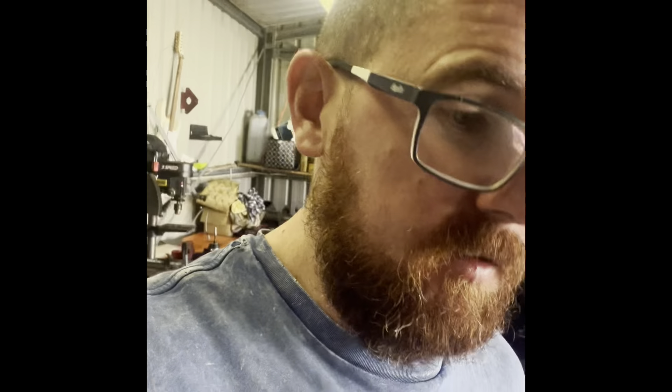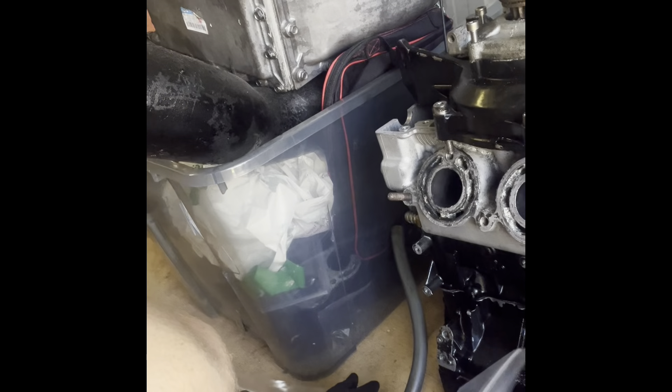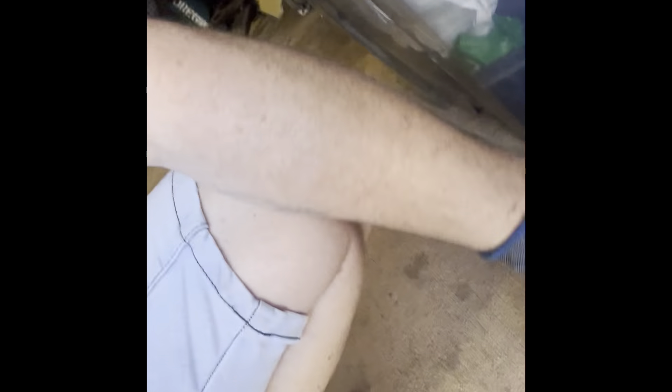The story is I swapped for a Kawasaki 250X. The other thing was in the way, so I wanted something a bit smaller to have a look at. I pulled the engine apart and found some quite bad damage — basically that piston let go, as you can see in the bottom of the sump there. Piston exploded, major damage to the engine — smashed all the oil pump up, smashed the bottom end, smashed the casing. Could probably get it going, but it's going to cost a lot of money to get that back together. So I decided to get another motor for it.